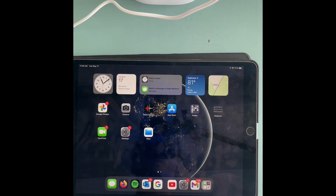I do know that you can also sign in directly to the modem and do a network selection from there, which I think is a little bit easier. It's a couple more steps, but you get to see what current network you're on, and you get to make sure that you're switching from one network to the other.